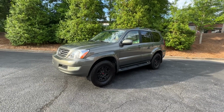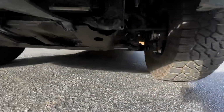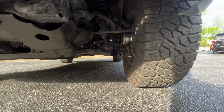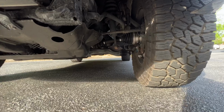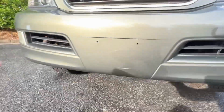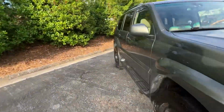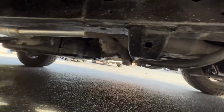So like the lower control arms, one of them had been replaced, but cam bolts were original, so we swapped out lower control arms, swapped out and cleaned cam bolts, CV axles, axle seals. The auction had undercarriage pictures, and it looked nice and clean, black, but looked like it had been undercoated. But once I got it, it had been undercoated. So frame, everything is solid.